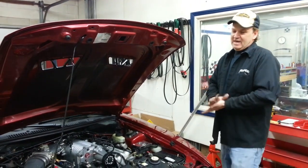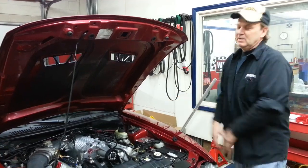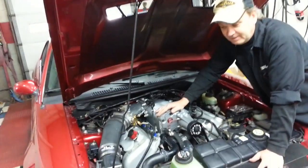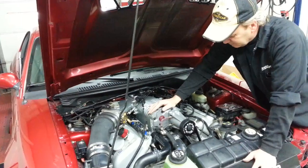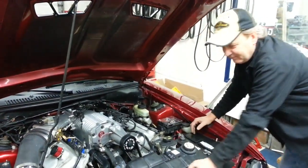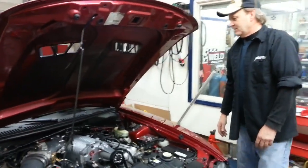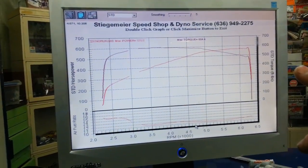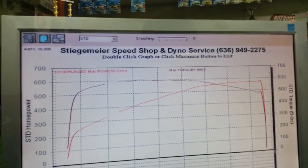So basically he's going to go put gas in his car, let's say he puts 5 gallons in, multiplies by 0.2, bam, he's going to put that E85 in there. Right now, this thing is like 94 octane, actual octane. And it's running 23 degrees of timing. The air was cool last night, probably 35 or 40 degrees, so it was optimum conditions when we ran these numbers. But here's the last dyno sheet. I know it seems somewhat incredible, but we've made a lot of advancements, and this Stage 8 has really proven itself.